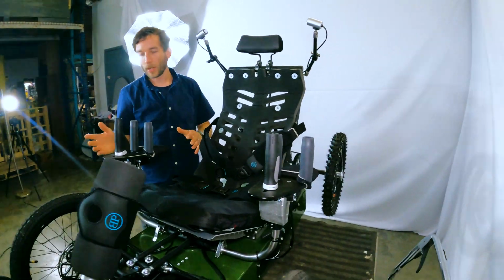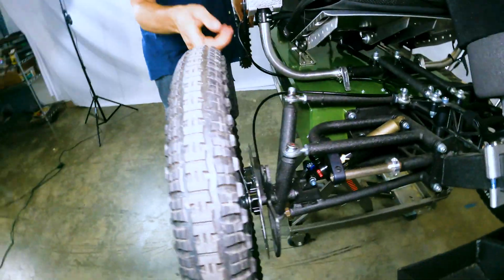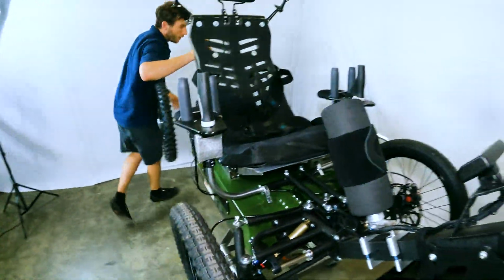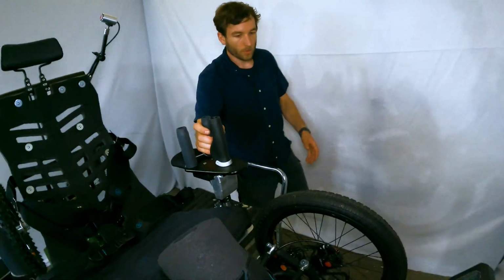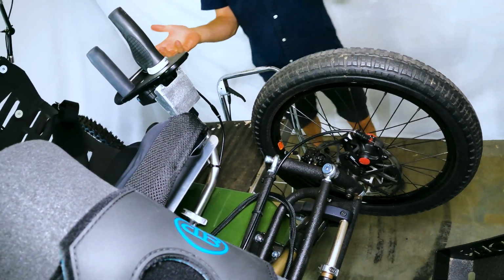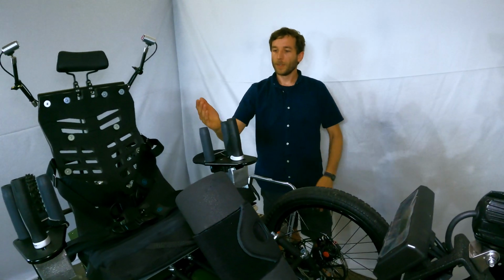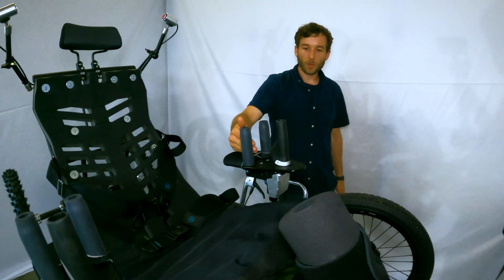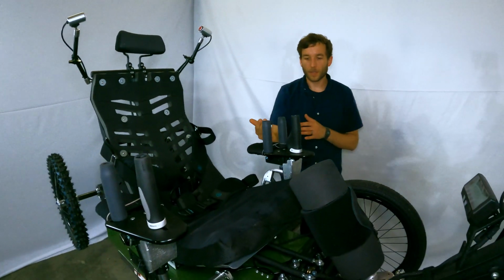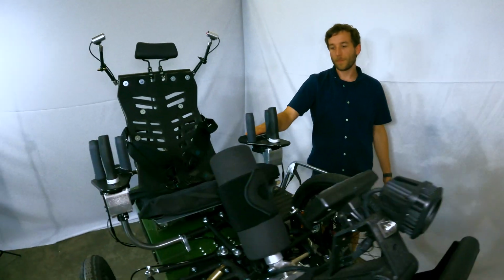And also the brakes can be set up to be independent, like this one is. So your front right brake is going to control your front right caliper, and the front left brake on this one is going to control, of course, your front left brake caliper. For someone that has almost all of their control inside their left side, it could be set up for single-sided left controls or single-sided right controls with the tri-pin. That is possible. However, that does require that you'll need to apply double the braking force on that one hand.